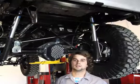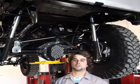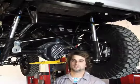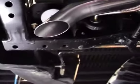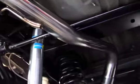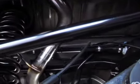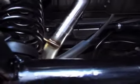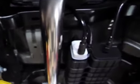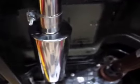So the rear section of our Jeep, just following back here from the muffler, we did an off-road turn down. The system is designed for the off-roader, but it does not mean it's for off-road use only. We don't affect any of the emissions stuff — it's all still factory. We did an off-road turn down tailpipe so there's no chance of hanging it up on rocks or trees when you're off-roading. The tailpipe is not really visible out the rear; it's tucked up nice and high. Gets rid of that ugly looking stock muffler in the back and probably saves you a few pounds in weight as well.